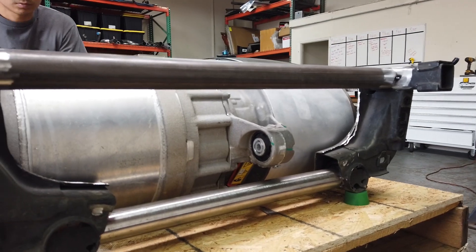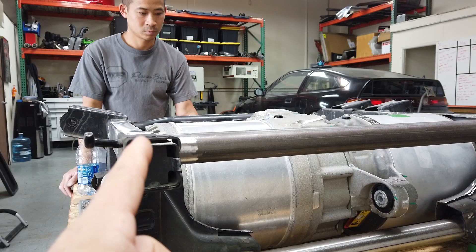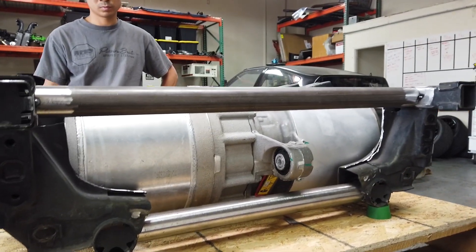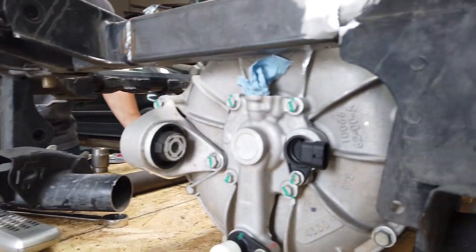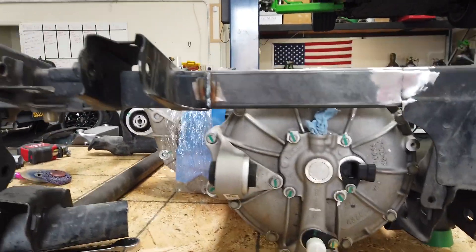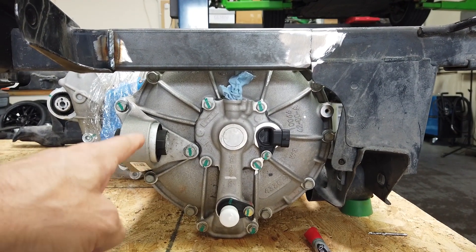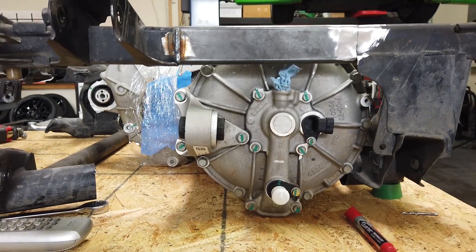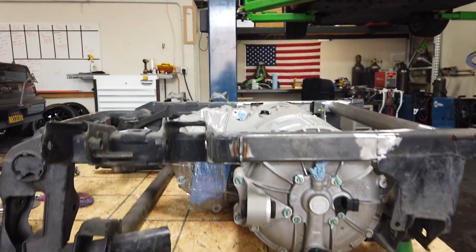You can see this is our rear mount right here, and then we have a bar welded as structure for the top and structure for the bottom, and we're going to build a mount bracket off of that. On this side, the third mount is going to be a little interesting because we actually have a lower arm that needs to get modified. There's something very close to this mount area, so that mount may have to be removed and relocated as the third mount.